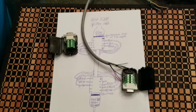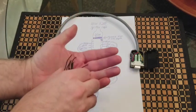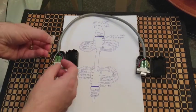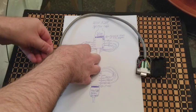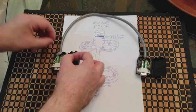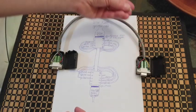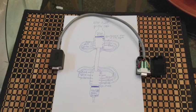I've got all wires connected. I ended up clipping the black wires off each side to have more room. Once everything is in, use the included piece of plastic to pin the wires down, and two screws — one on each side of that plastic piece. This prevents yanking force from pulling on the wire insertion points, giving you a solid, durable adapter.